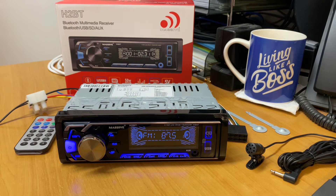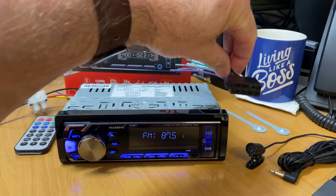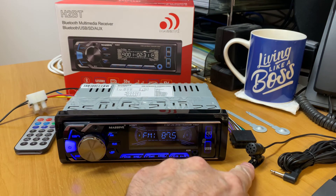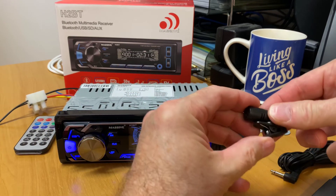I can say it is a fantastic unit. With the installation side, it does have ISO plugs so it's nice and simple — if you've got those plugs it'll plug straight in. Microphone placement is very important. Make sure it's up where the mirror is or on the right-hand pillar, so you don't end up getting crackling or noise through your microphone. Most brands — pretty well 99% — recommend putting it where the mirror is, or you can put it on the cluster above the steering wheel so you're talking straight into it. It has a little clip so you can clip it onto the panel.